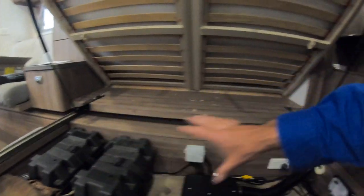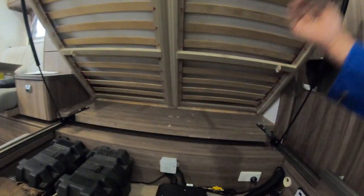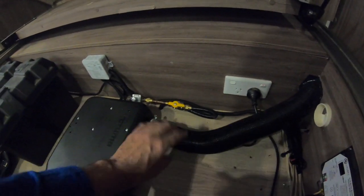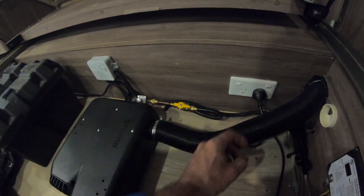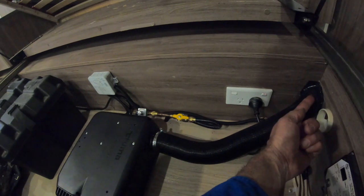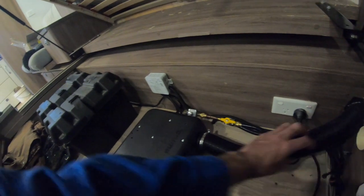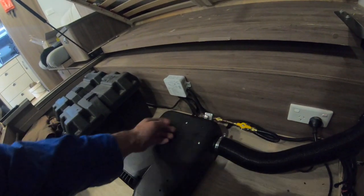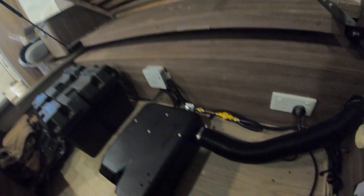With this slide, there was no way I could get into it. We took the bed off and nothing like that worked. So what I ended up doing — here's the exhaust pipe, the external exhaust pipe. There's a smaller one inside that the hot air blows out, and because it's a room-sealed appliance, the combustion air gets sucked in around just inside the big outer pipe, and then the exhaust gets blown out. So it's being cooled down the whole way — it's a really good system.